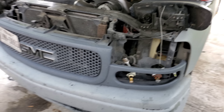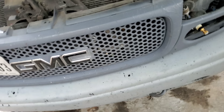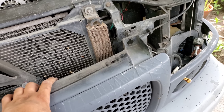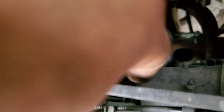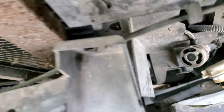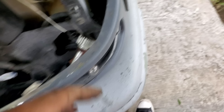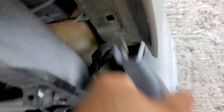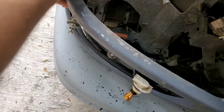I need to get new headlights because this one has the housing broken. I'm gonna swap out the GMC badge on this one since it's not black, but I'm probably not gonna use this bumper anymore - it's trash to me. To take off the badge, there are little clips - you push the bottom of the clip and push it out, then find something to push the top and it'll pop right out. There are also clips on the sides - just pop them out carefully.